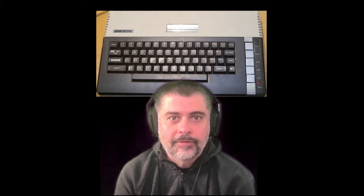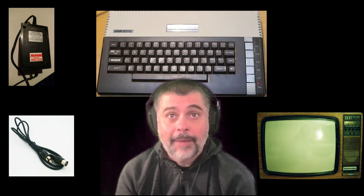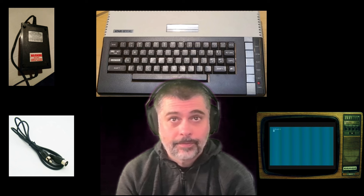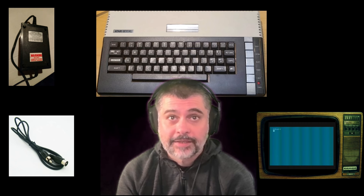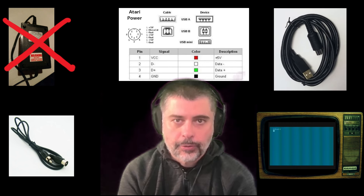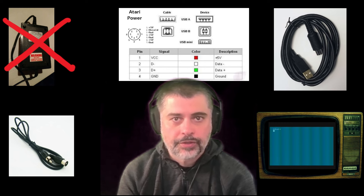When I unearthed my old Atari, being impatient, the first thing I did was plug the power in, plug the aerial RF lead into an old television, and I was happy to find I could get a picture straight away — the unit did indeed still seem to work. What I should have done however was checked first that the power supply was safe, because research I've done since shows that many of these old power supplies can degrade, provide over-voltage, and damage your Atari. I went ahead and replaced this with a USB-based power supply and I'll try and provide some links in the description.